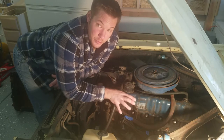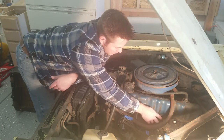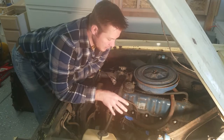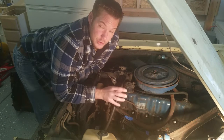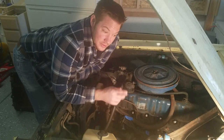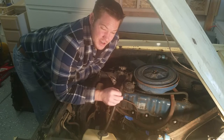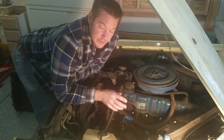The most important thing you can do is take out your spark plugs and put in what's called fogging oil. Fogging oil is designed to help store your engine and keep those cylinders and the cylinder walls lubricated so that the next time you try and turn the engine over or rotate the crank, those cylinders haven't rusted or gotten stuck to the cylinder walls, making it really, really hard.